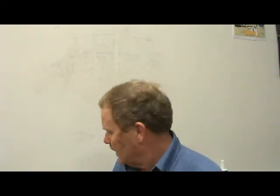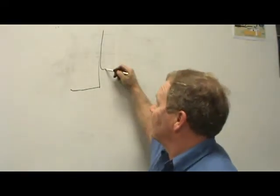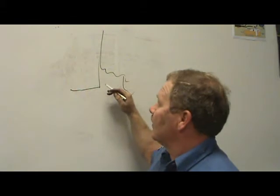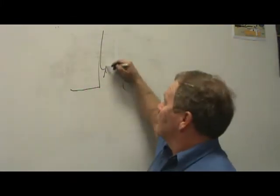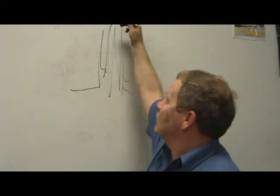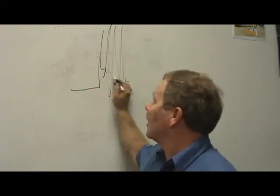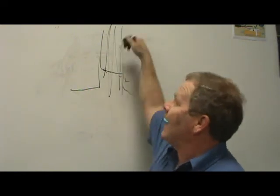I'd hook it up, and one day I had one that was running bad. And this is cool right here: whenever it was idling, you had a fairly normal spark line. But when I'd rev it up and it would be missing and cutting out, this was all over the place. The spark line would spike up even higher than the firing line.